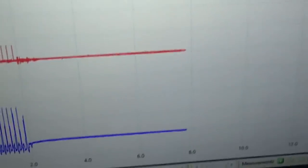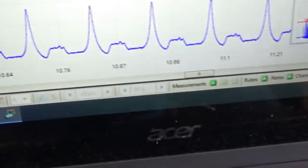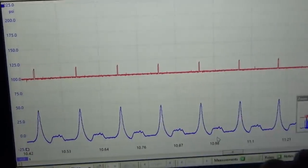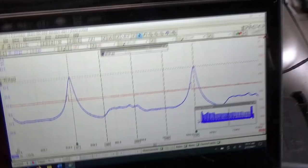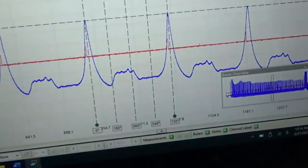The spark is definitely there. There's our in-cylinder pressure — let's rev it up and shut it down. On cylinder one the peak compression at idle is 43 psi, which might seem low, but we need to compare it to cylinder number two to know if that's normal for this car.